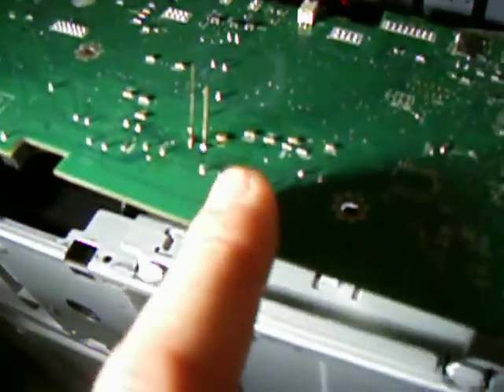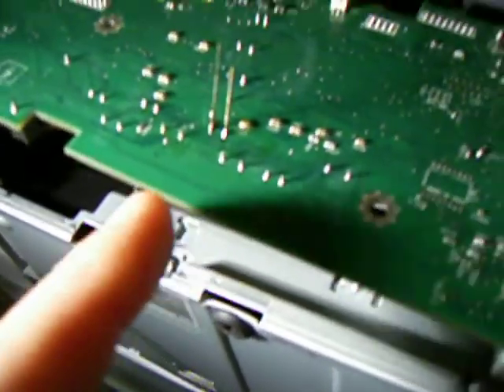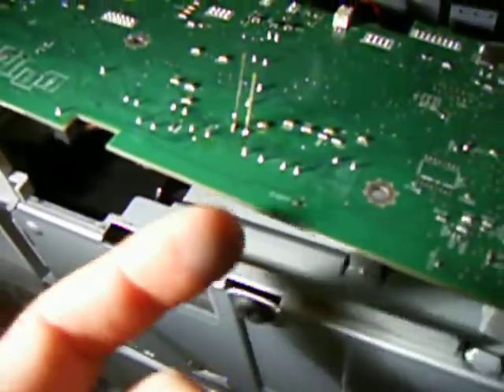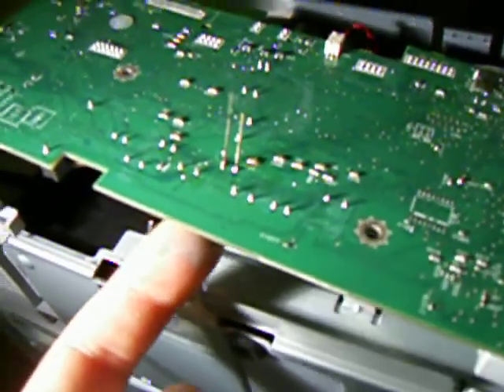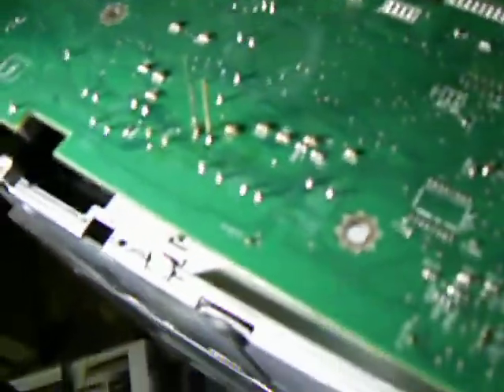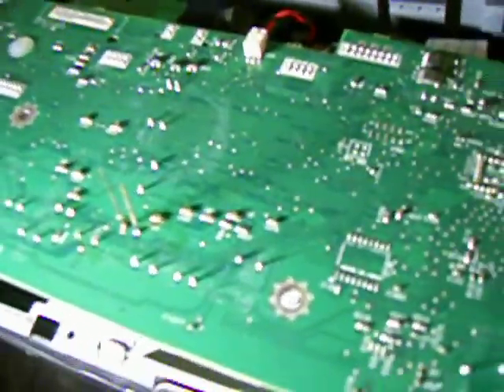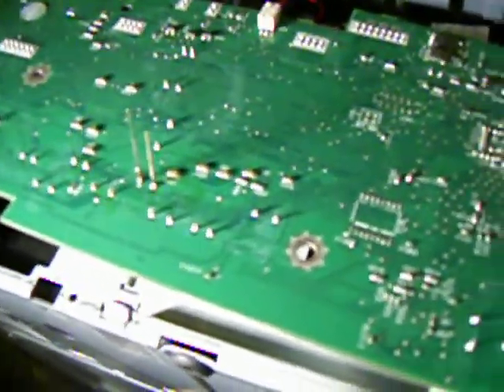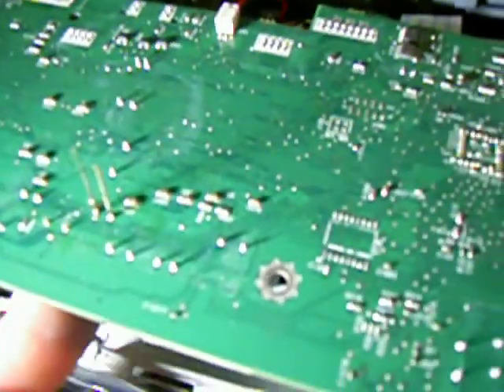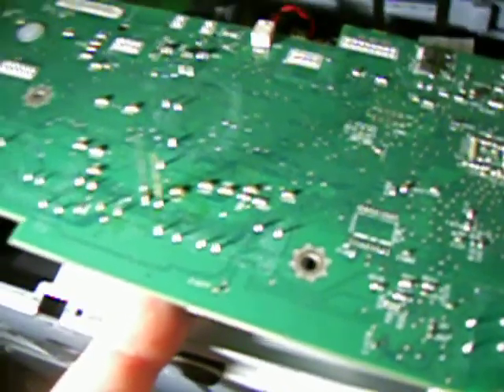What I'm noticing on this board, and probably most new circuit boards for the last 20 years, is it's double layered, which means it has copper traces on both sides. It's not easy to tell which side needs to have the electrical contact — sometimes it's both sides, sometimes only one. For these capacitors it's easy to tell once the capacitor is removed. I'm guessing it's the component side, not the solder side. Once you've wicked out the solder, remove the old capacitor, look down the holes and make sure the old solder is wicked out as much as you can, because if it's not, it's going to be hard to insert the new one. Do not hold the soldering iron on the bare hole very long, because these fine traces will melt — and it's not worth trying to fix if you damage the traces.